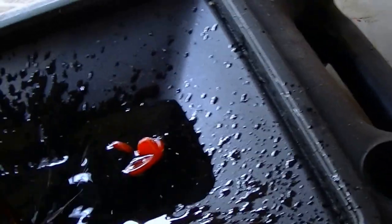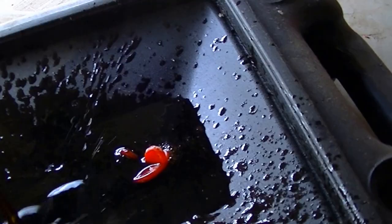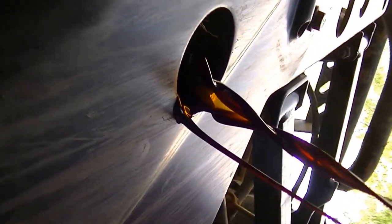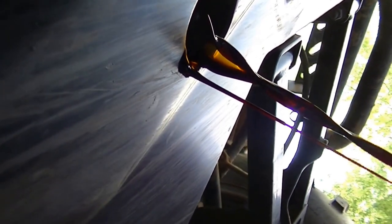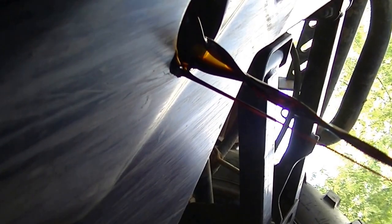So the oil doesn't look too bad. Everything looks fairly good. The problem with these Gators is that under here, it likes to run all over the place. When it comes out initially, it's just all over the place. I don't think there's anything you can do other than maybe put a piece of plastic right there, but it's not going to hurt anything. We're going to drain 2.3 quarts out, put the cap back in, and refill the oil, start it, and recheck the oil.